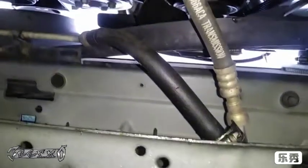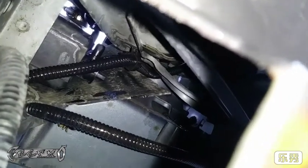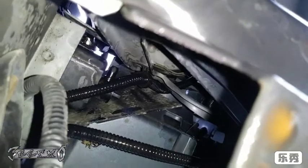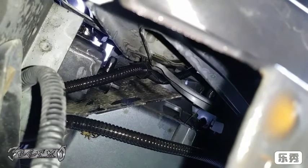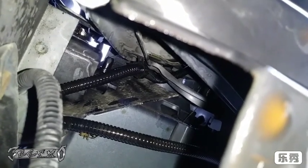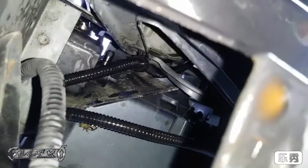I'm underneath right now on the passenger side. The drain to this radiator is up in this little nook — get the wire harnesses aside. It's that black thing right behind the harness; you twist the end piece and it loosens it and the coolant comes out. Super tight spot, not my favorite. People usually put a hose on that drain and let it pour into a bucket — neat and not messy — but this is just too tight, so I'm gonna drop the lower hose instead.